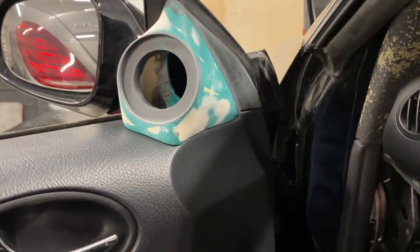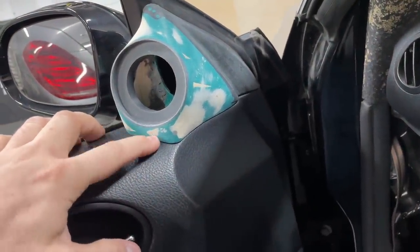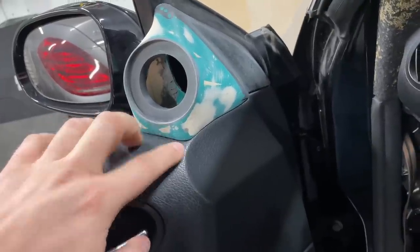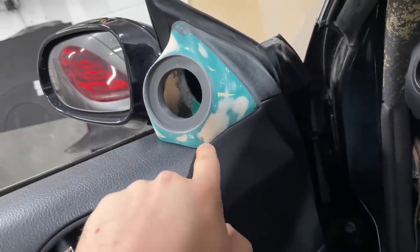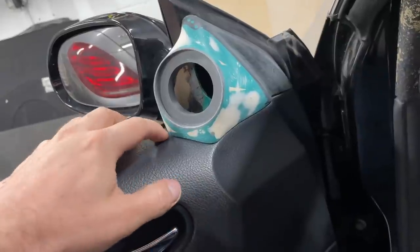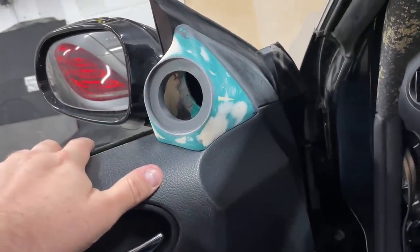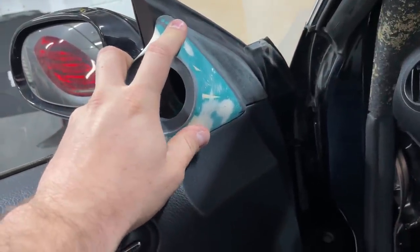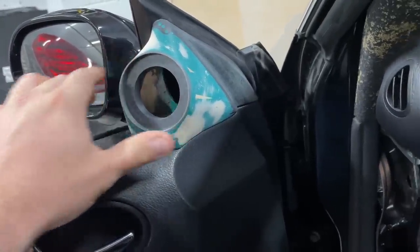Actually, I don't have to do anything with them because I thought I would have to tape it up and then refill it again, but my original mold was done so well, and I didn't sand any further than the line. That's why it's nice to put a Sharpie line on the masking tape, because that transfers onto the mold from underneath, then you can see it. So they are done, and you will need double-sided tape underneath because that clip holds it on the top, but yeah, double-sided tape is going to hold it firm.